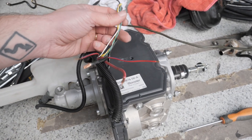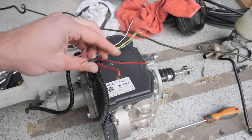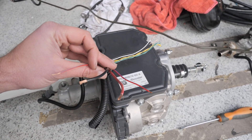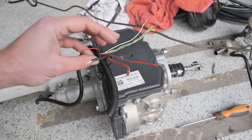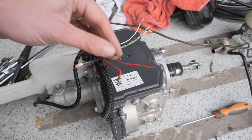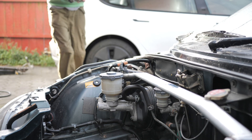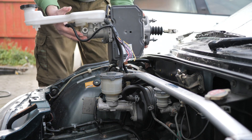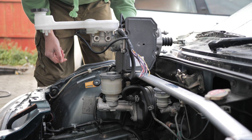So I'll wrap up these wires, keep them away, or maybe put them back in here, and then extend them so they go all the way from the front of the car to the battery. And fuses — I need fuses. There's a 40-amp fuse that goes to this one, and a 5-amp fuse that goes to this. Wiring this up is on the bottom of my list of things to do, but I'm glad at least I know it works. First I have to actually mount it in the car, and that is going to be a challenge.